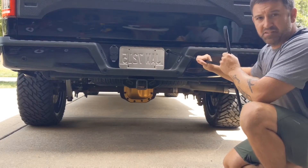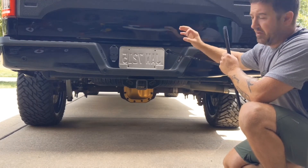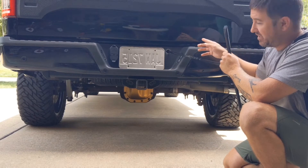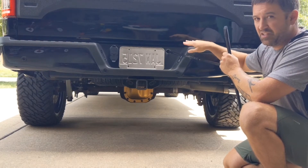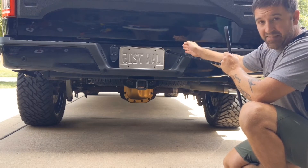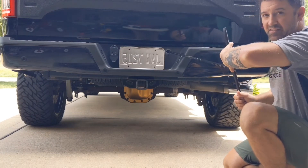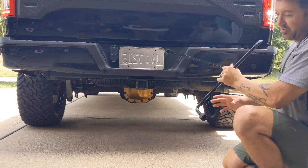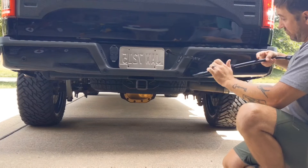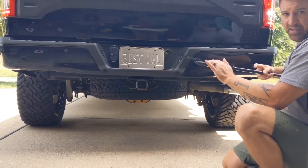Our next step is to take this apparatus that we've created and stick it into our lock hole here. There is an actual canal — if you take a flashlight once you remove the barrel lock and shine it down, you'll see there's a canal. Go ahead and take the fat square side of the breaking bar apparatus and stick it in that canal until it locks into place. You'll have to spin it a couple of times to get the square to line up. Once it lines up, turn counterclockwise — left to loosen. Once you do that, you'll see that your tire is starting to drop. Just keep spinning and it will drop all the way down until it sits flush on the ground.